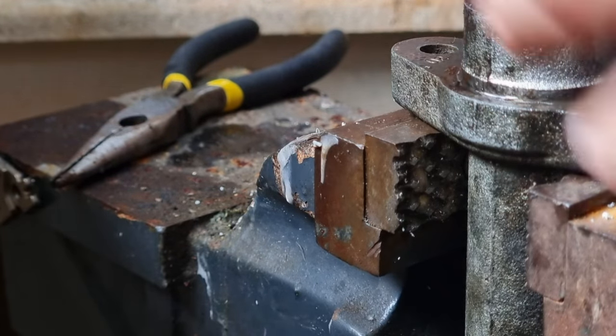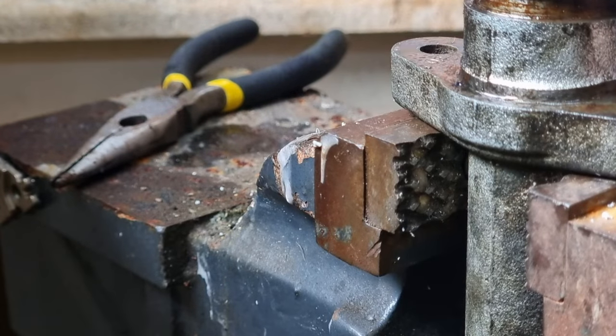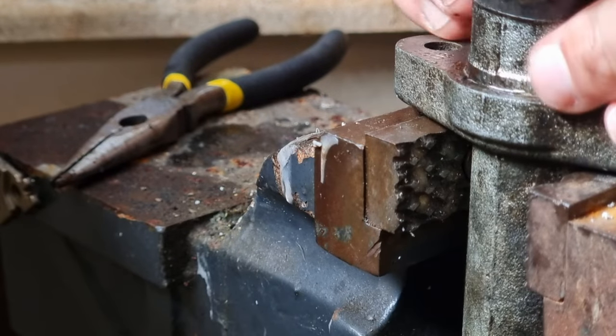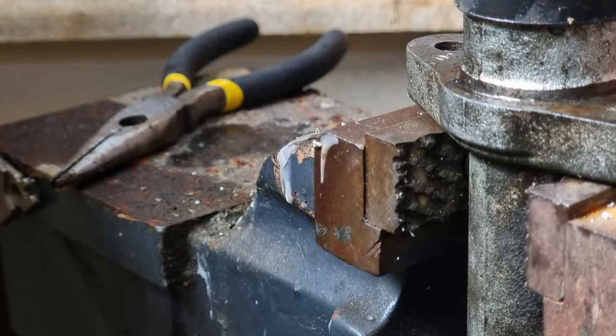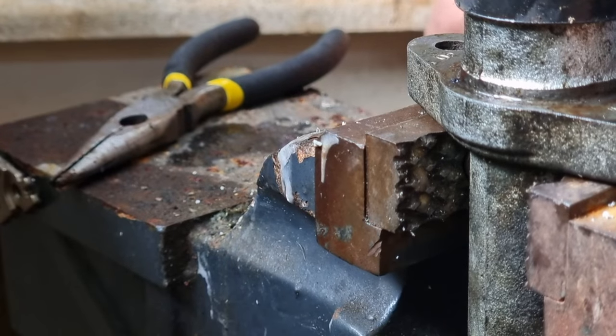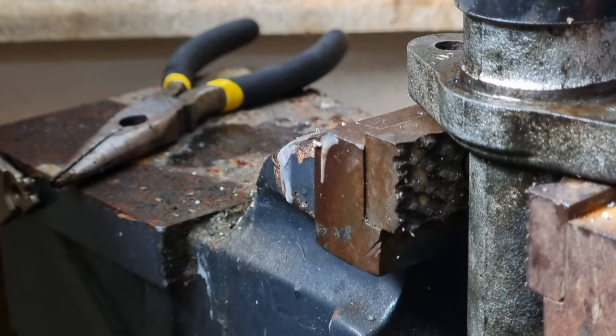With the spring back on, this would be relatively easy to reassemble or refurbish. But the new one I've already put in will probably last quite a while given my use case. If I have to do it again I'll get a stainless-sleeved cylinder. To summarise: there was rust in the slave cylinder, the fluid was very crappy, brown, and had water in it. I'll put this on the spare parts shelf — I can reuse the boot or recycle a piece of it in the future, but for the most part this one's done.